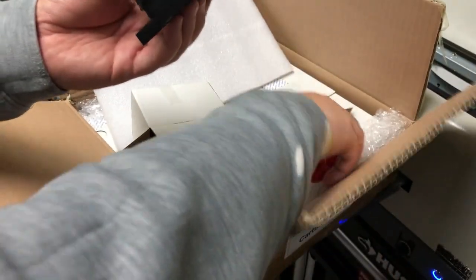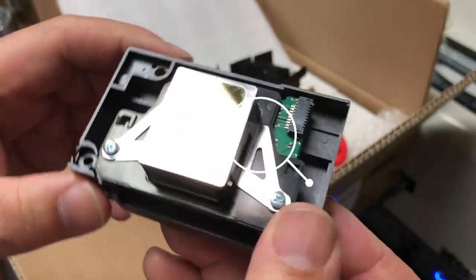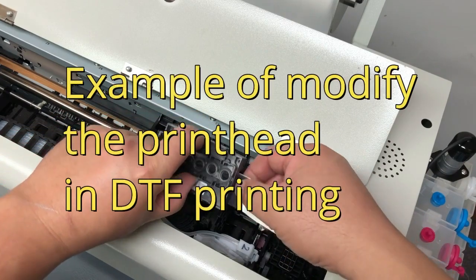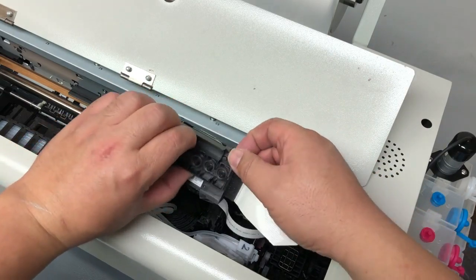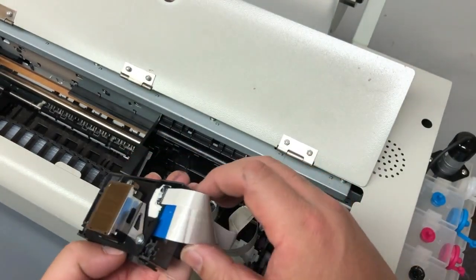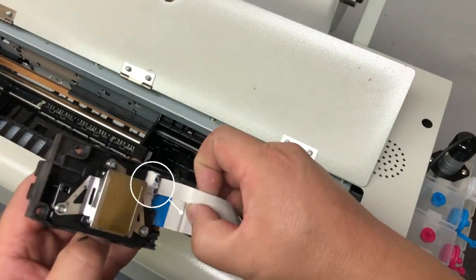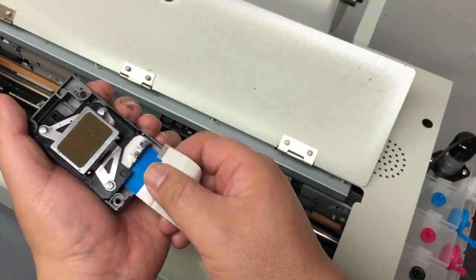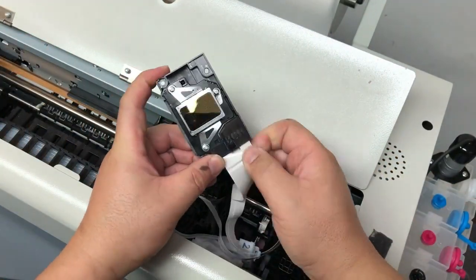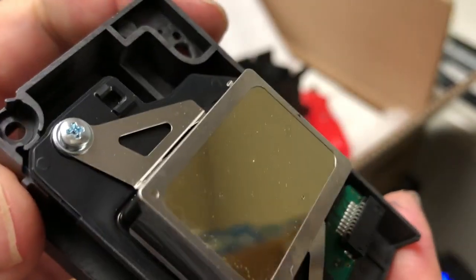And Epson's printhead has one more tape here. If you flip it over, you're going to see the green PCB board. I have a video showing that this exposed PCB board is a design flaw and you should put a printhead cover on it. If this printhead was used for sublimation or DTF before, you can see some companies put white glue on it to protect the board - but it's not really effective. You should really just put a cover on it. You can click the link above or follow the link in the description. For a new printhead, you should see the exposed PCB and there should not be any white glue on it.